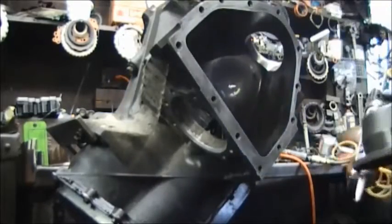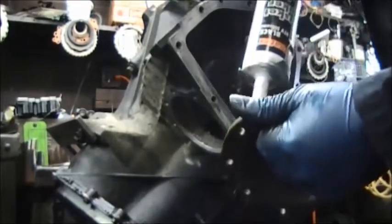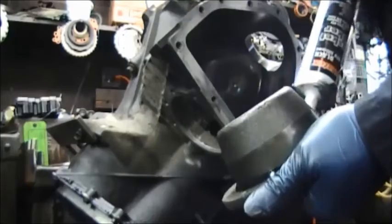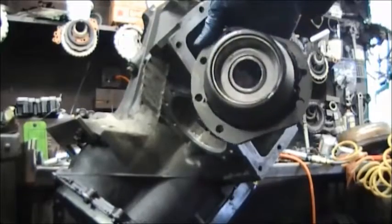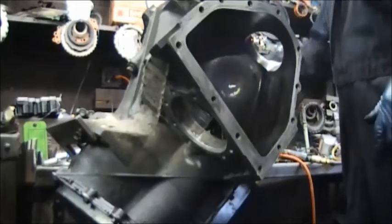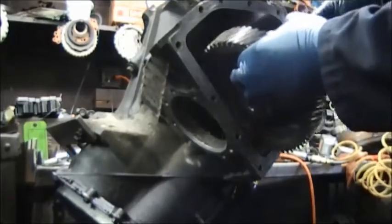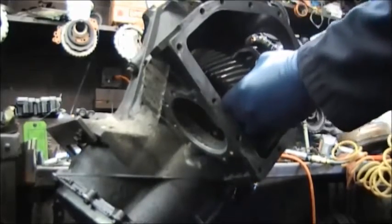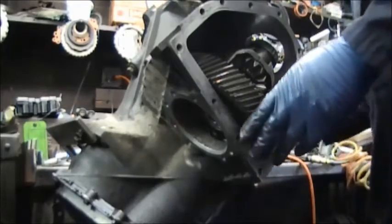But the purpose for that, not the retainer pin, but the differential shaft pin with the 3 notches in it for the spider gears, is designed again to aid in stopping it coming out of the case. The spider gear normally grabs around that pin because it has very little lubrication, and over time pieces of the gears wear off and debris goes into the transmission. The filter catches some, but some of it is washed up, and anything that is small can plug up.